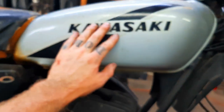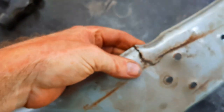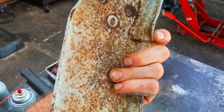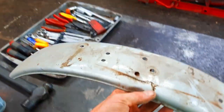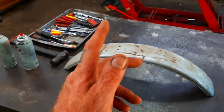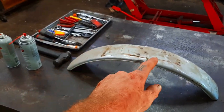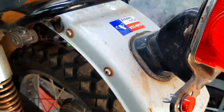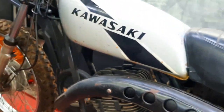Now the front fender — it's cracked, so I'll have to repair it, which means welding, which means the paint is going to get messed up. I have a choice between leaving the weld marks — which I'm not going to do — touching up the paint in just that area, or repainting the whole fender. I'll probably repaint the front fender and possibly the rear fender as well. As for the tank, I don't want to repaint it — I'll clean it up, doctor it, and spray some new clear on it to keep the original paint as original as possible.